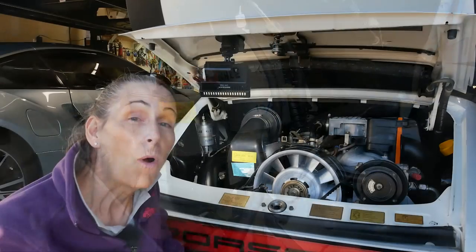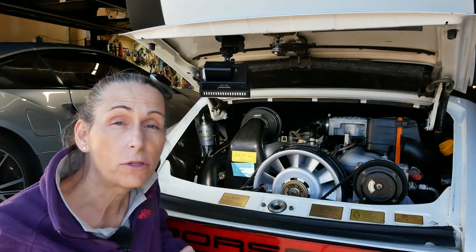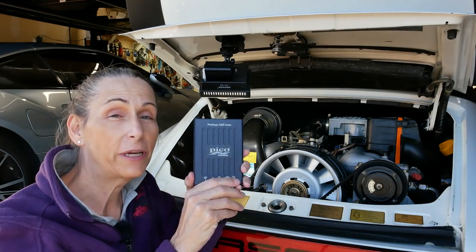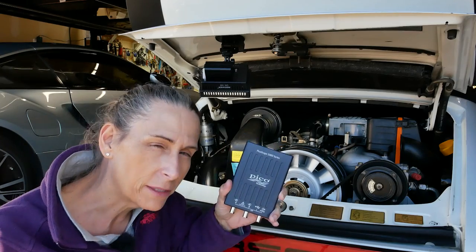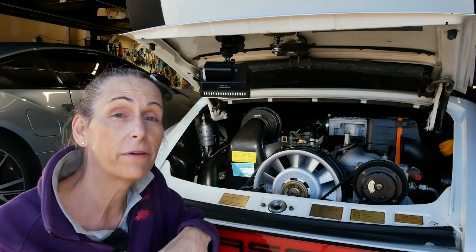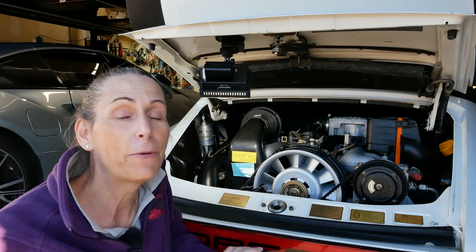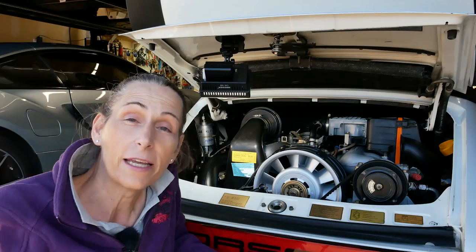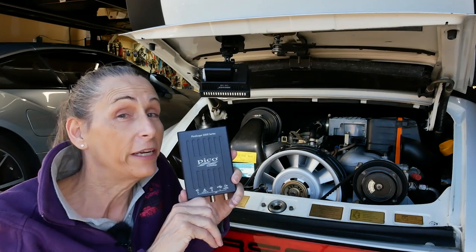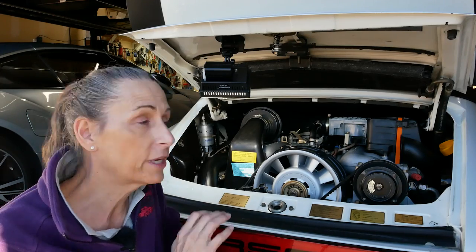We got quite a bit checked out on the car — the airflow meter looks great, our position sensor and speed sensors look really good, and we were even able to do a bit of a compression test. This little Pico scope is pretty neat, and they're not very expensive — a little over a hundred bucks. You do have to buy some probes and it takes a bit of practice to figure out how to use it properly, but it can tell you quite a bit of information. We got a good look at our ignition and were able to test our black coil. The black coil was just fine so I put it back in the car. You'd want to take one of these if you're going to buy a used car, because it's all non-invasive — you just clamp onto stuff and it tells you quite a bit about what's going on inside the engine.